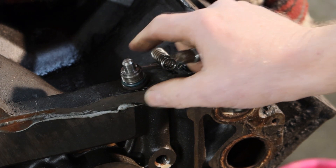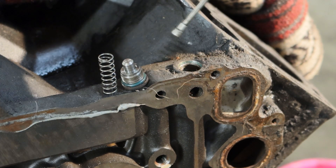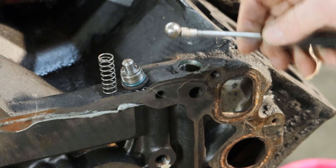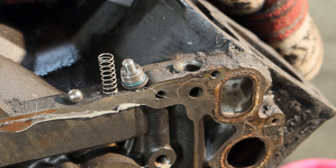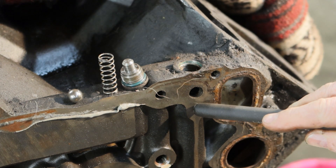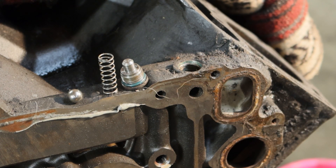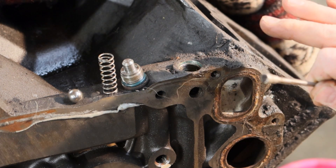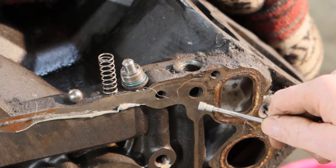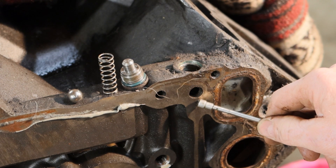So we have the plug, the o-ring, the spring, the check ball — the anti-siphon ball — and also inside of here is a crown. Don't forget about the crown; that crown could be worn out. If your reserve tank is going dry, there are some other possible reasons, but they're very rare. This right here is going to be the highest reason why your reserve tank is going dry.